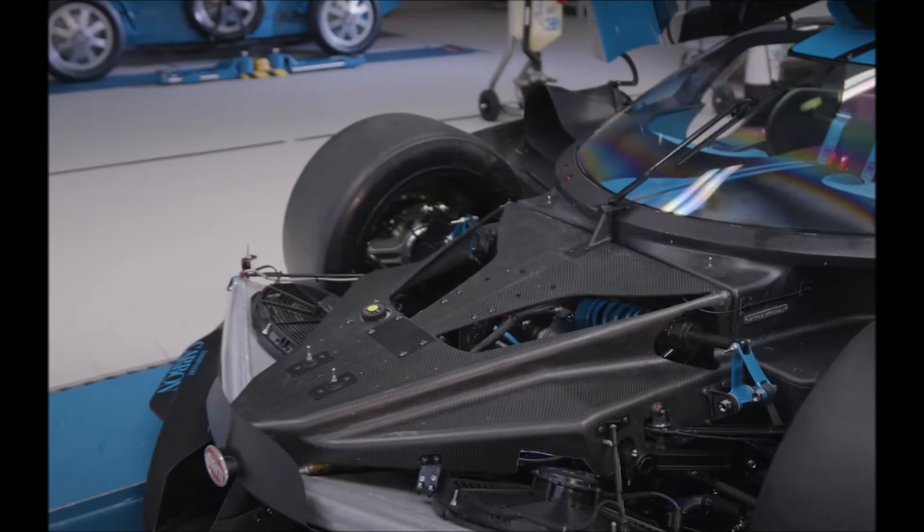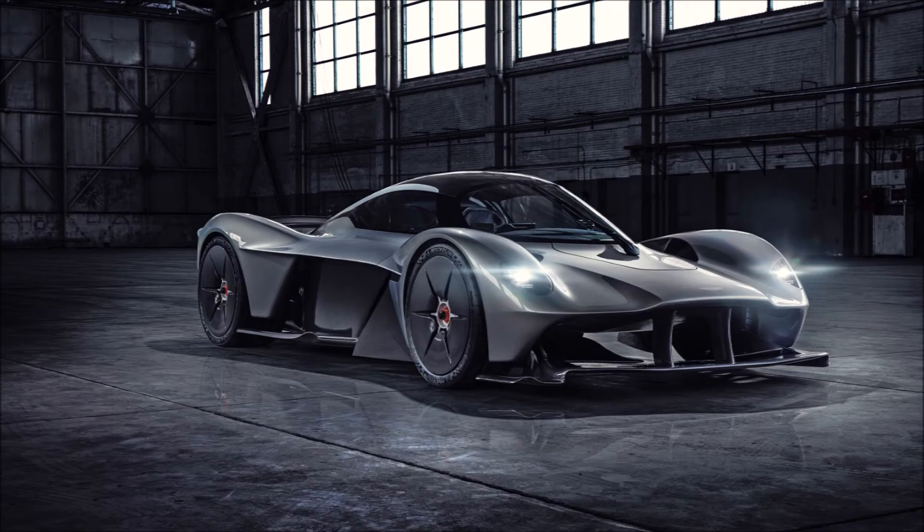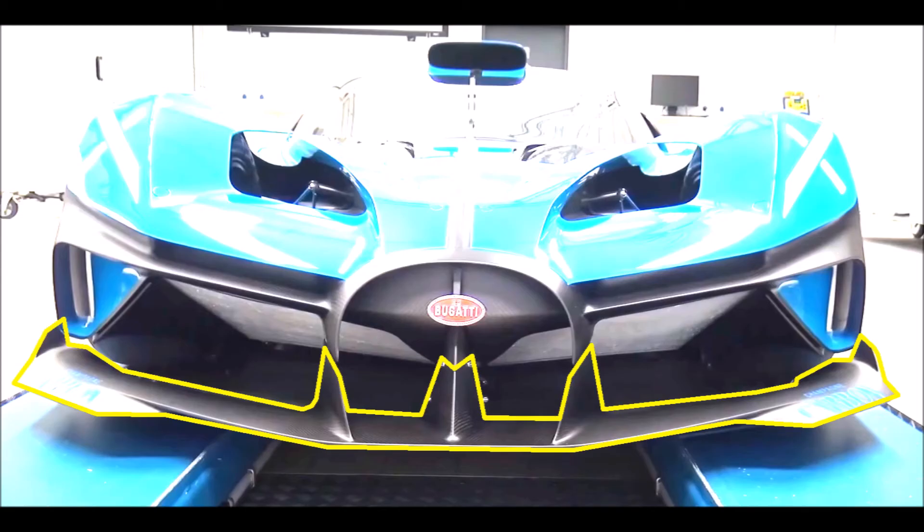It's a pretty nice arrangement in front with the top carbon fiber cover, with the crash box covering the gap between the two radiators, and with one fan either side. I'm a bit surprised that they put these big radiators in this position at the front because they obstruct the flow through the front axle and it will reduce downforce. Thinking about cars like the Valkyrie, in that position it doesn't have any radiators and you have a free flow through the front axle with a real front wing arrangement. The Valkyrie has a front wing with flaps, while the Bugatti has a simple front wing which is only mounted in the center. You can adjust the height of it — Bugatti stated it can be adjusted in three different positions, and for that function it makes sense that it's not connected anywhere else. Even the Bugatti horseshoe is open and it will be interesting to see how stiff that component will be.